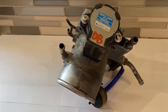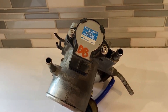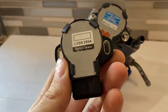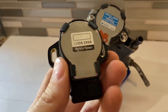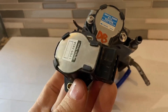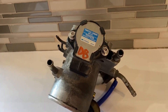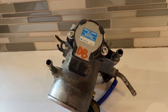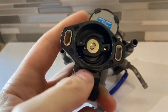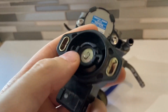I recommend using the OEM Toyota sensor if you can, because the aftermarket ones just aren't as good. We had a Taiwan sensor on there and it kept throwing a code 41 for the throttle position sensor. Just because you're throwing that code doesn't necessarily mean the sensor is bad — it could mean it's out of adjustment, or it could mean that on the back side, this assembly is gunked up. This is spring-loaded, and if it's full of gunk, it won't return back to its resting position.